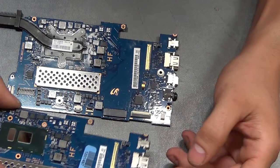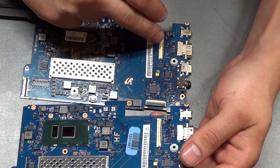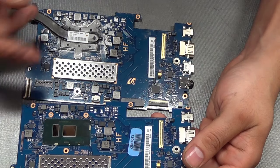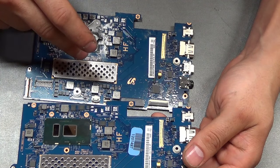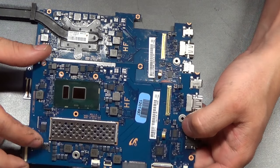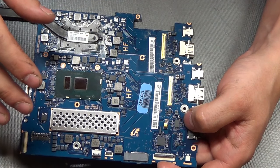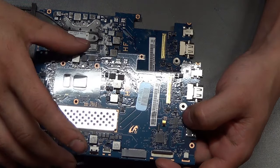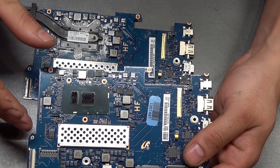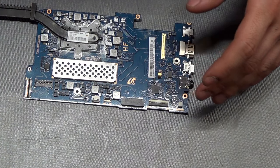Once you get the replacement component, before you get too into it, try to find and match all the numbers on the stickers and any numbers on the little chips, and the location of the ribbon cables. Like I said, this motherboard is actually from a slightly different variation of the exact same series of laptop. Let's see if that works. The company I got it from — I will post the link below. Really good people, they answered my emails, and it was shipped the same day, three hours after I paid for it. Just try to match the numbers. Once you install the component, it sometimes leaves marks, and this is a brand new motherboard, so you might not be able to return it if the seller sees that you've actually installed it previously.